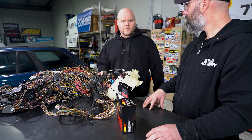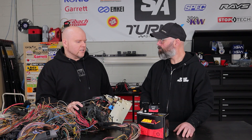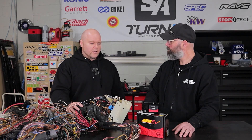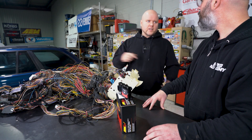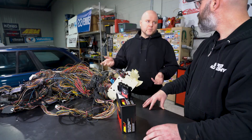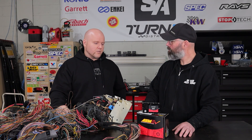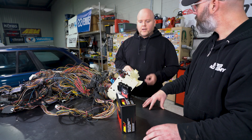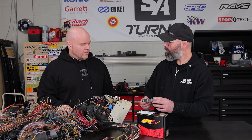Most PDMs have different kinds of logic builders where you can set this stuff up. AEM has taken an interesting approach — it's basically like an ideal satellite PDM. For example, in mine I have the ECU Master in the main area of the car running the motor and all the functions, but the trunk is far away. So even though you've reduced all this wiring down to only one wire per function, you still have to run a wire for each function the entire length of the car. But what if you could do all of that over two tiny little wires for CAN bus? You bolt one of these onto the back, program it over CAN bus sending a message saying 'turn this on when I say so,' and now you just have a short length of wire from this to whatever function it serves, and everything is communicated over CAN bus.